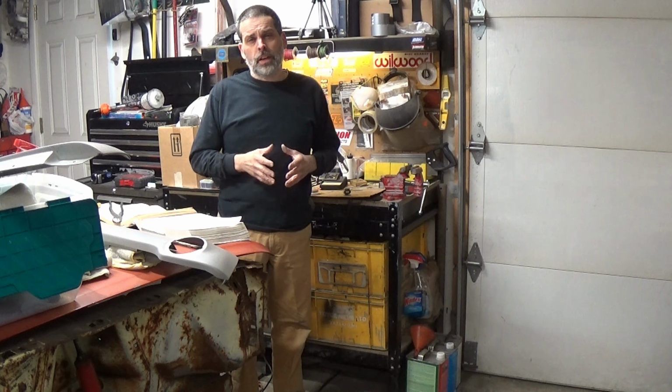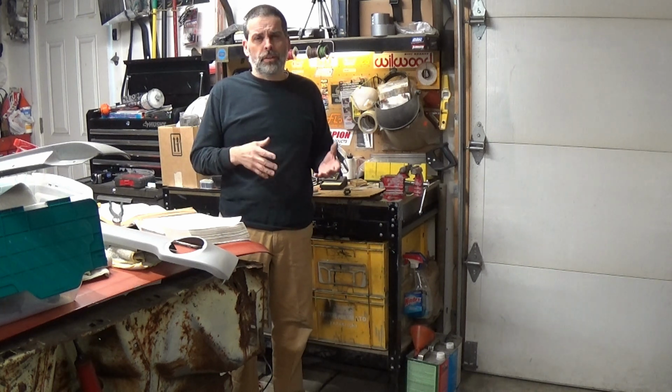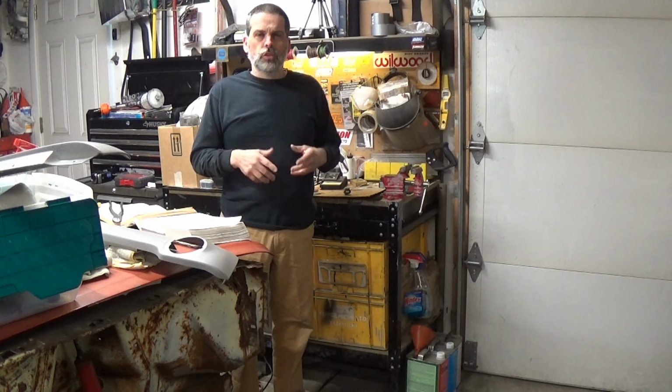When I teach automotive electronics at the local community college, I always relate things back to car stereo systems, because students almost always have some experience putting in speakers, a head unit, or an amplifier. That relates to one of the questions I get asked most about troubleshooting: my speakers go out sometimes, what do you think it is? Sometimes the power goes out in my radio, what do you think it is? I always ask, did you solder the wires? Almost always the answer is no. They just twist them together and put some tape around it, a bad way to put wires together.